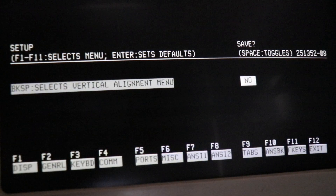With the WY55, I set up these parameters, and then saved with F12, space, and then a second F12.